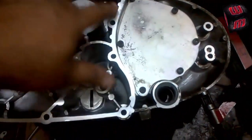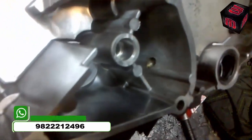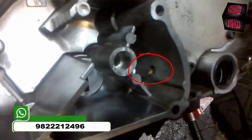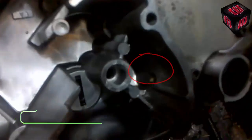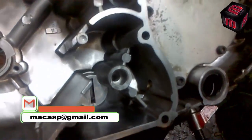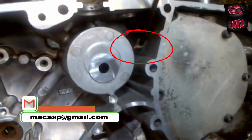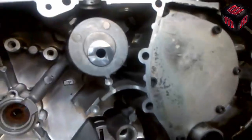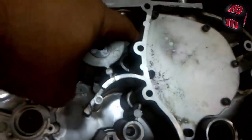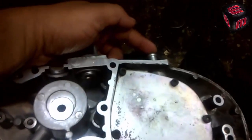I'm going to open it up and show you the tracking system. Before that — this is the hole from where oil comes down, where the separated oil flows down from this port into the magnet casing. If you see this upper port, the air goes in from there. These are the separators: air goes in, oil comes out, and the separated air comes out from the breathing nipple.